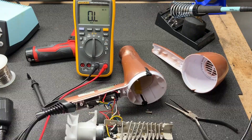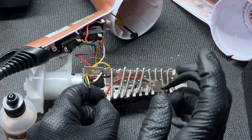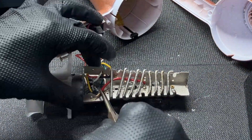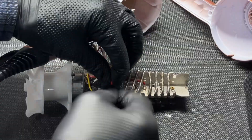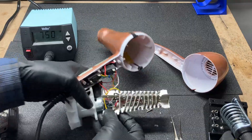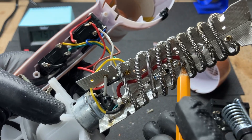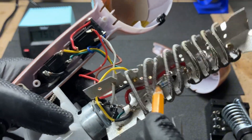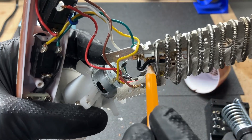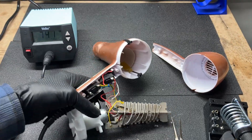We'll duplicate what we did for the thermal switch, except this time using a red wire. I had a little problem that the wire wouldn't actually fit through the studs, so I soldered it towards the top. I've bypassed the thermal fuse so all current will flow through that red wire — very similar to what the reed switch bypass is. Now we have a bypass on both sides, on the thermal fuse and on the thermal reed switch. With that done, there are zero safeties left. See you outside at the box.